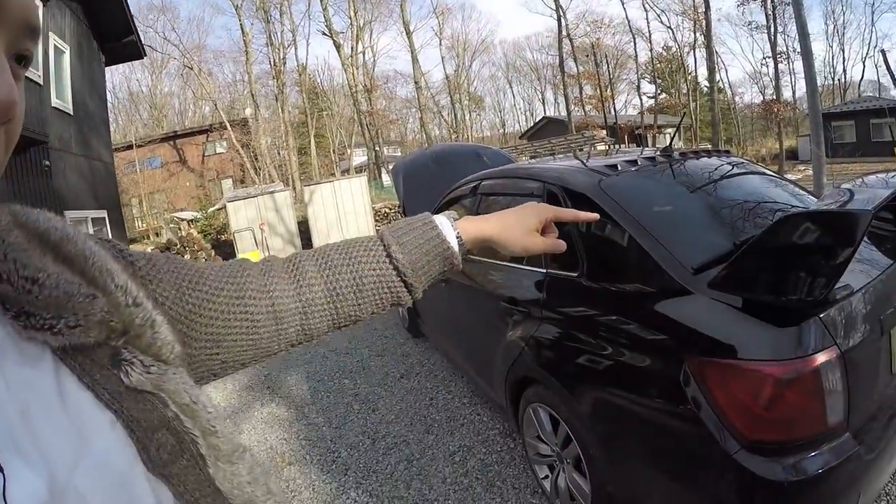So far I'm loving this suspension — the ability to adjust the firmness and damper rebound is just amazing. It gives you a lot more freedom to set up the suspension for whatever kind of driving you want. That's why it says Road and Track. Adjusting the back is not really hard — you just have to pop the trunk, remove the carpet pad and stuff like that. There are little knobs on top and you can turn it all the way to fully closed and from there it's just little clicks.